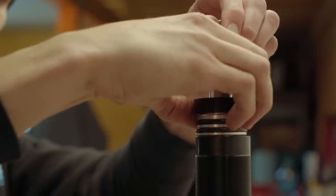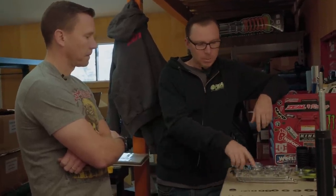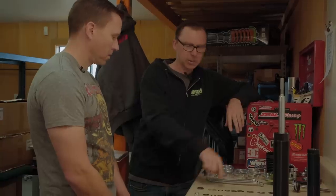A large piston is your friend because a lot of surface area makes it easier to create resistance for fluid flowing through. On a twin-tube shock, if you have a small piston and try to create a lot of resistance, it just generates a lot of heat. The shock is compressing and rebounding, doing a lot of work, creating a lot of heat. The most important factor with shock fluid for a shock tuner is the viscosity index. You can use thinner fluid to make the shock softer; if you're having trouble getting the right force through shim stacking, another trick is to use a different fluid viscosity. That's really what separates one shock from another — how much time a manufacturer spent at the racetrack or on the shock dyno figuring out which shim configurations work best for a specific car and driving discipline.